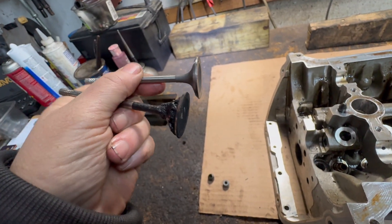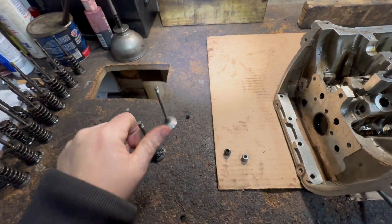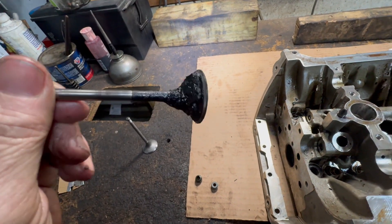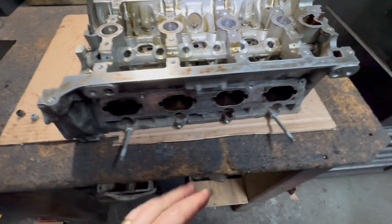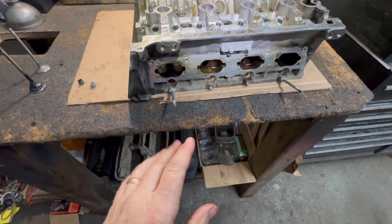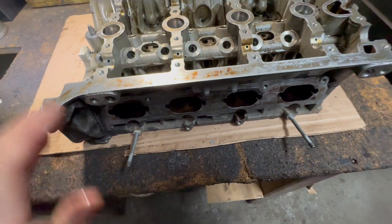The valves can be clean — I just replaced so many of these valves. But this carbon can be cleaned. Can it be cleaned in the car too? It can. They have certain ways you can sandblast it with walnut shells, and it can do a pretty good job. It's a lot less expensive than taking the head off.